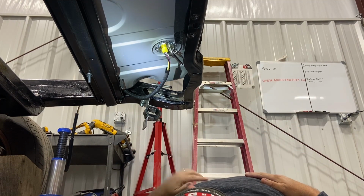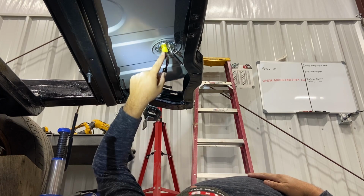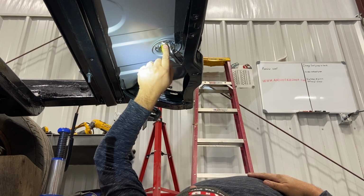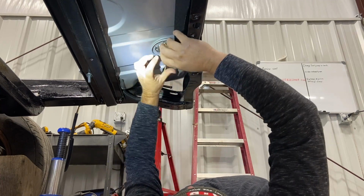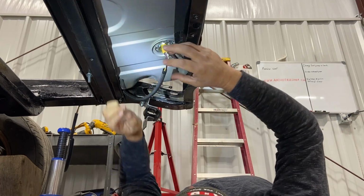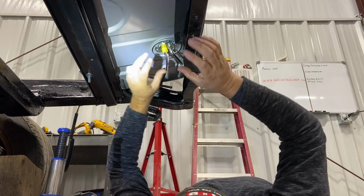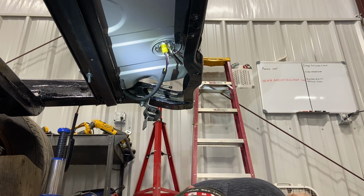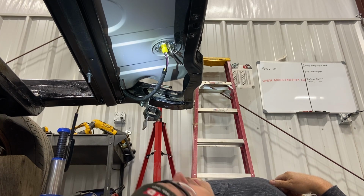So that is Holley Fuel Pump. Like I say, the only sketchy thing is pressing on that ring hard enough to get the O-ring to compress. Because on a normal gas tank, when you're on top, you can just press down and lock the ring in, get it to go in. But here, you don't have that luxury of being able to press down and actually move, and all that good stuff. So, yeah. All right. Well, now we go on to some other Corvette stuff.